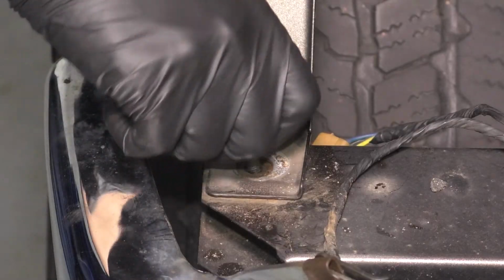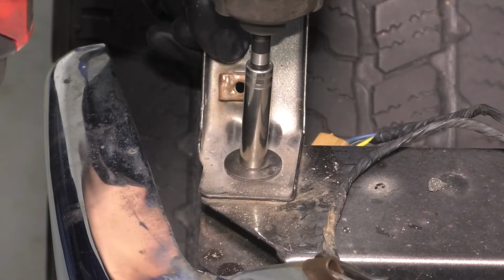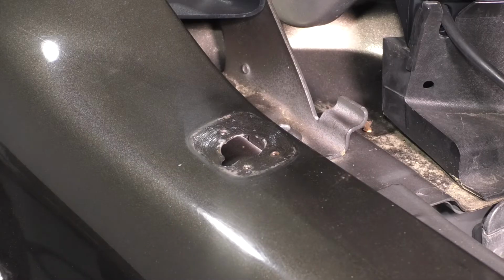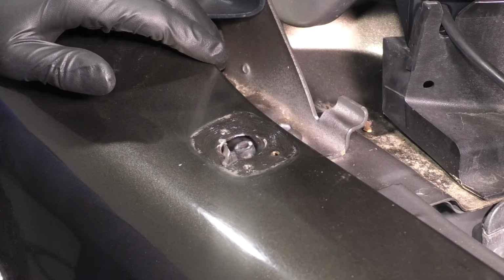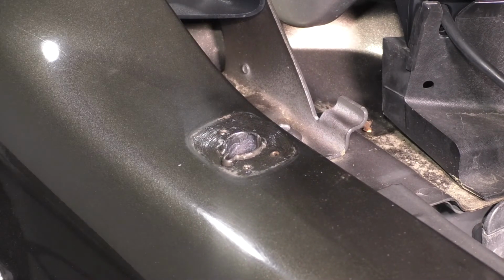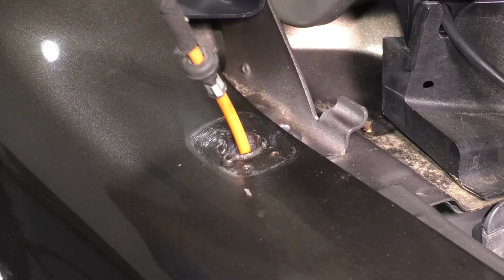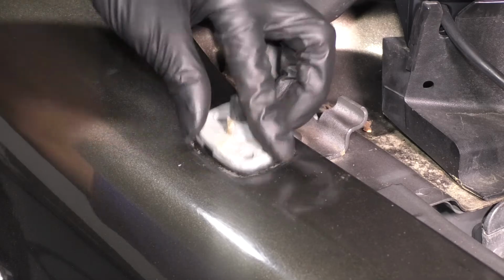Right at the front here, underneath where the headlight would mount, let's resecure the bracket for the fender. From underneath, let's put this piece on, which is just a bracket that allows you to thread in the mounting screws for the antenna. Slide it up. There we go, that's pushed into place. And now we can take the antenna cable and slide that down, just like so. I'm not going to route it yet, I'm just pulling it all the way down and securing it on here. There we go.